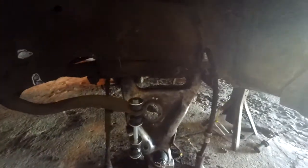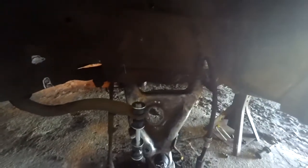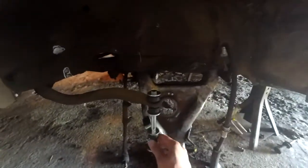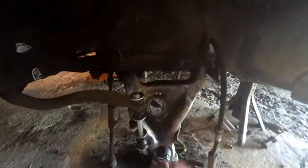We also started putting this side back together. We had to take this whole lower control arm out, this lower A arm. He took it to work and pressed the new ball joint into it, because basically the only way to change the ball joint is to have it pressed to actually put it in. The actual boot itself was a little bit too big so you had to take the whole thing apart, press it in, and then put the boot back on. It was kind of ridiculous, but he got it all cleaned up.